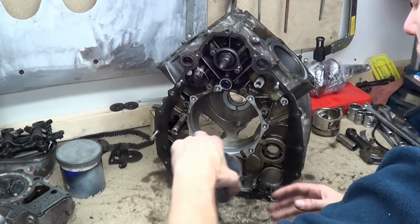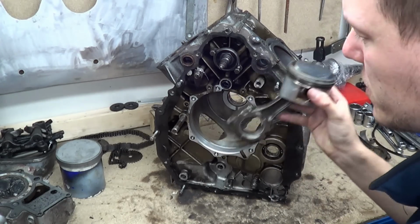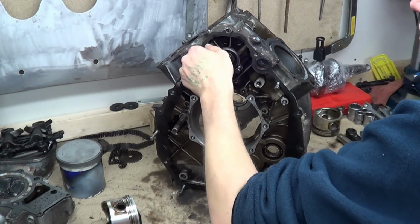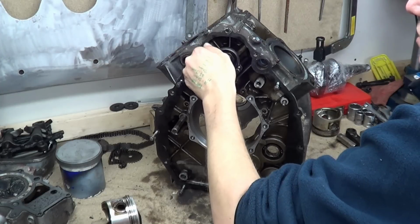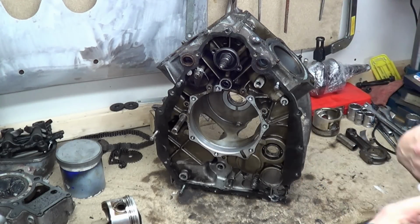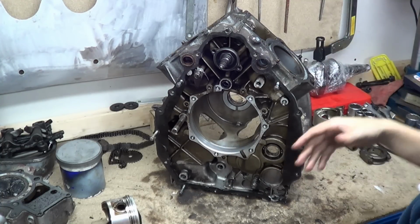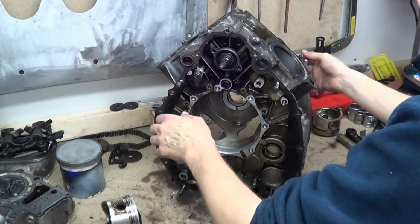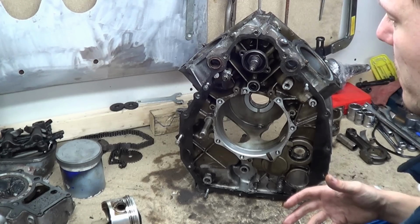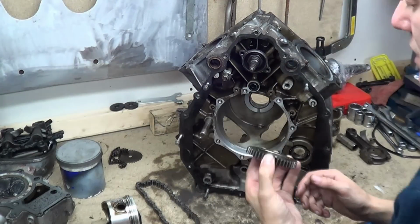So you have your piston, just like the two stroke, going up and down, up and down. The difference between a two stroke and a four stroke is not just the number of cycles, but also how it controls the intake, the inhale and the exhale of the fluid or the gas in and then back out of the engine when required. And that's the important bit. It's controlled. It's timed. It's controlled by timing, where the piston is in the cycle.